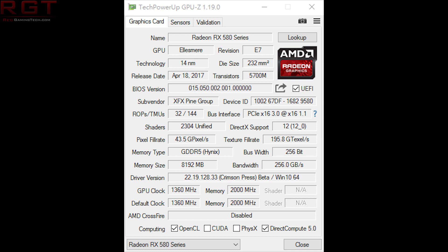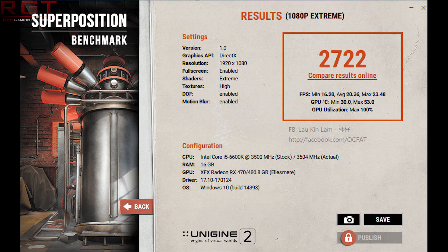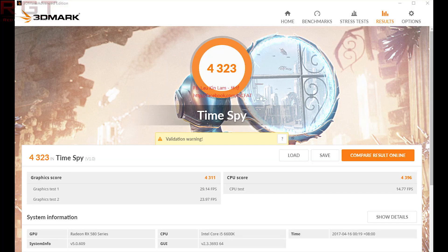The first combination was 1480 MHz on the core but 8500 MHz on the RAM, or 1500 MHz on the core but 8000 MHz on the RAM. In other words, one meant the GPU speed was slightly higher but at the sacrifice of RAM speed. The purpose behind this is the voltage — with 1500 MHz it requires increased voltage and does seem to be affected by a power bug, which means lower performance. So in his performance runs, it's better to have 1480 MHz and 8500 MHz respectively on the GPU and memory clock.